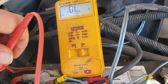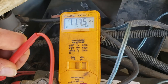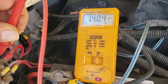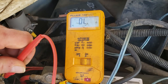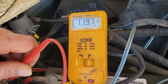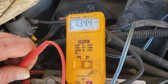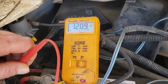And if you'll notice right here, that's the battery — the chassis battery right here — that's the voltage here. And up top on our battery isolator, that's the voltage of our lithiums, so our house batteries. Down here, this is our chassis battery. And now I'm going to have her hit that toggle switch again, and we'll see that voltage go up because the house batteries have a much higher voltage than the lead acid chassis battery. Hit it. And turn it off. So there you go — now our emergency start button is working correctly.